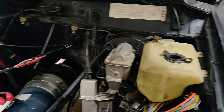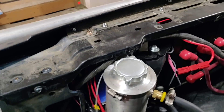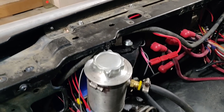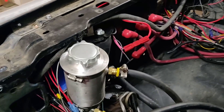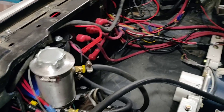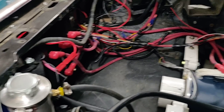This stuff over here is the brake booster and washer fluid — all regular. Then here, like I mentioned briefly, there's a vacuum pump to generate vacuum and a power steering pump. I actually have a switch so the power steering pump doesn't run all the time, because it does use power continuously. In the interest of saving power for more range, I have a switch inside the dash and I only turn it on if I need to parallel park or something. The vehicle isn't particularly hard to steer without power steering, only if you have to do very small maneuvers. So you can flick it on for 30 seconds, park, and then turn it back off.